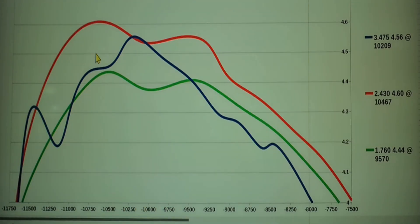Since we're dealing with such a small fraction, I wanted to be able to show you this. The lines aren't very smooth because we're zoomed in so far — essentially pixelated. We're hitting the range from 7,500 RPMs up to 11,750, and the horsepower range is only showing from 4 to 4.6. The very longest pipe I did — there's a little dip, probably operator error with the refresh rate on the tach and scale — but I never mess with those. Blue line is the longest stinger at 3.475 inches, and we hit a max horsepower of 4.56 at 10,209 RPMs.